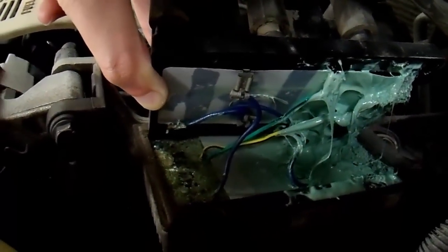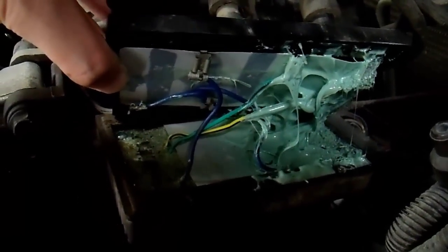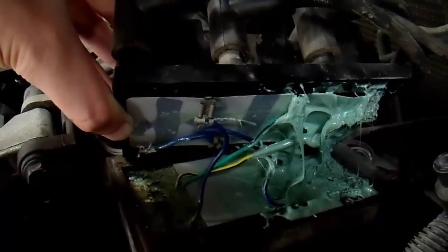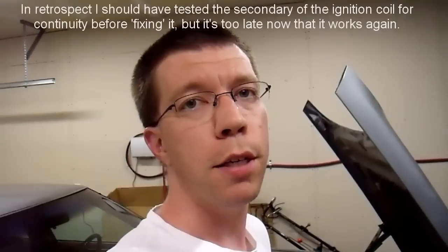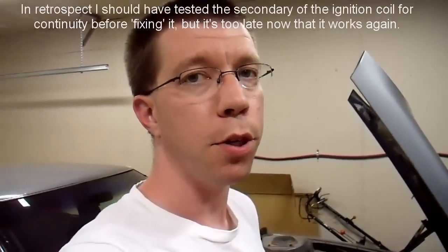I could re-pot this thing with some corrosion resistant material again, but I think I'm just going to clean all these contacts up quite well, re-crimp them so they're nice and snug, re-assemble it, and go on my merry way. So there you have it — the ignition module on my car failed and it was just a bad crimp. I'm just going to re-crimp that and hopefully that's the only problem. It's also possible that hammering on the ignition module to get it loose kind of fixed it temporarily, but I'm pretty sure it was just that connection. I'm going to do this, and hopefully I have a zero dollar fix. My car seems to run just fine again, at least in my garage. Thanks for watching.